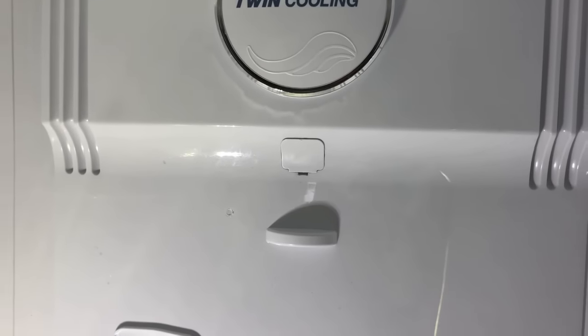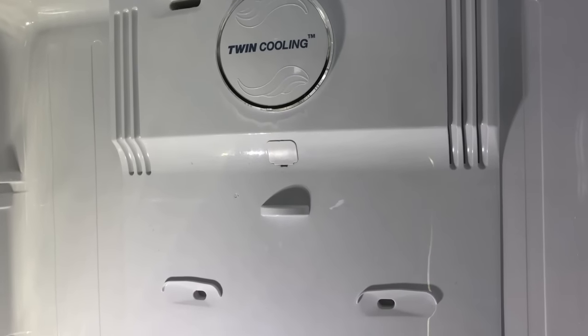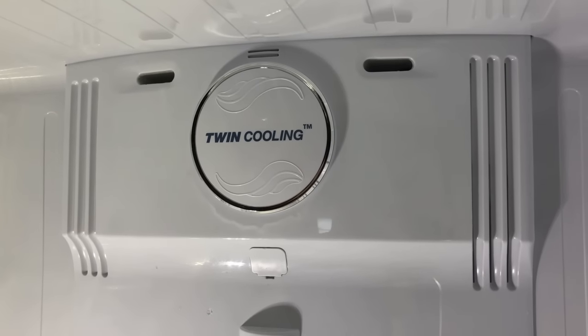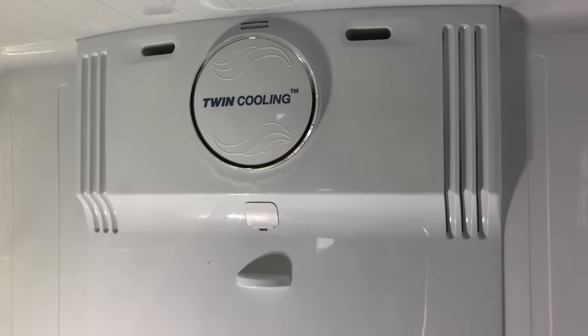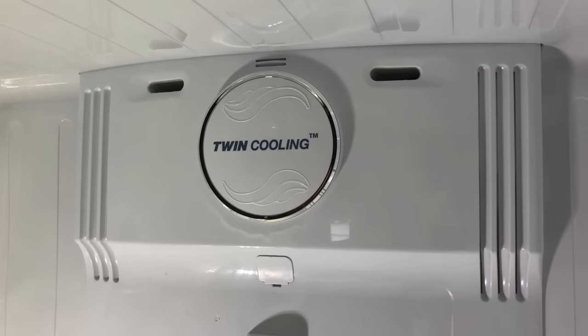That's it — all put back together. One thing to keep in mind when taking this panel off: have patience and go easy with the hair dryer on a low setting. You don't want to melt the plastic. Work your way around the bottom to free it up. Some people just let it sit overnight to thaw and then the panel pops off. If you're having difficulty getting it off, it's probably due to ice behind it. Pretty manageable job — I wish I didn't have to do it, but hopefully that'll resolve the issue with water forming in our crisper trays.